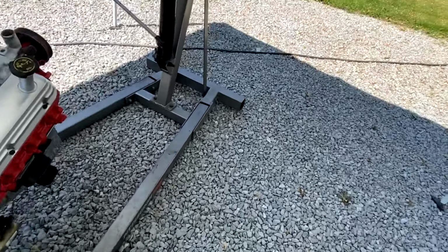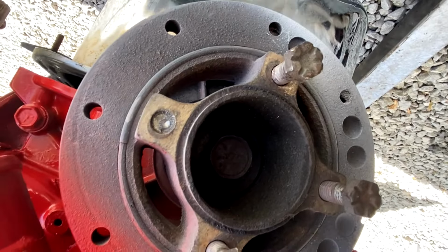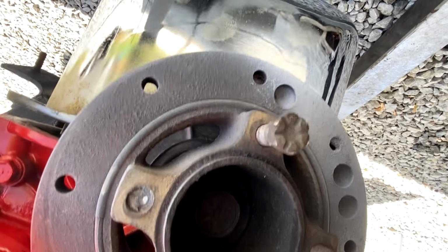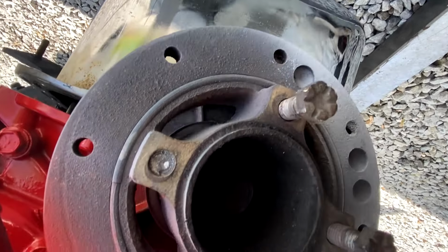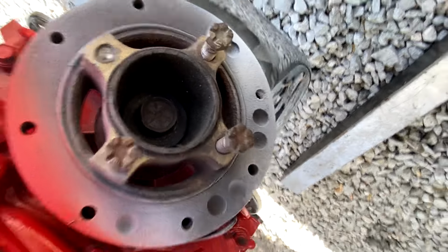I can't get that bolt out. Tried to drill it. That's why the kid was saying the balancer was junk, because they snapped the bolt off in it. I didn't hit center, and I couldn't get nothing to drill through it anyway. So I'm going to pull it off later and try to lay a nut on here and weld right into it and weld the nut together and see if I can screw it out that way. If not, I got to buy a balancer. No big deal.